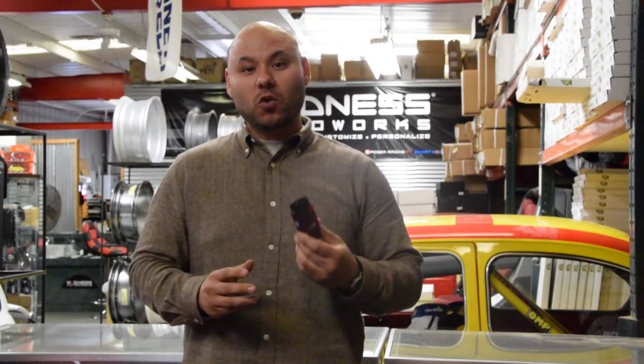Well, the auto flash is going to give you that same type of increase. What all those manufacturers are doing — the reason you're getting that bump in horsepower and performance isn't because they've changed the drivetrain of the car whatsoever. They've actually just gone in and tweaked the tune, and by tweaking the tune they're allowing more horsepower, more torque. So the auto flash is going to plug in and allow you those same parameters on the TCM module — the transmission control module — and that's going to allow you the increase in performance.